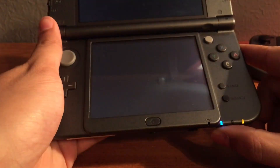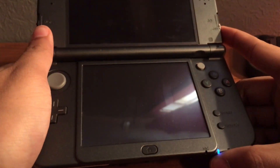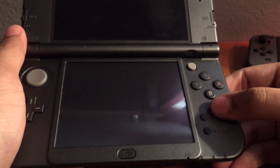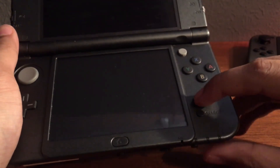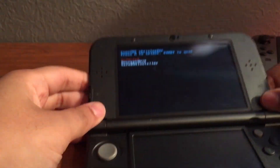What you're going to do is turn off your 3DS and turn it back on, but before you turn it on, make sure you hold the Start button. This will launch into Luma Chain Loader, or it may already launch directly into GodMode9, however you have it set up. Mine is going to launch into Luma Chain Loader and I'll boot into GodMode9.